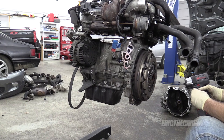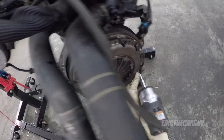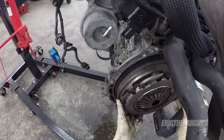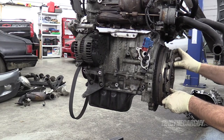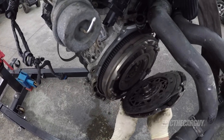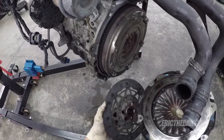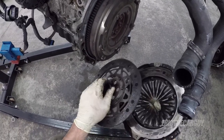This looks like an E10. That doesn't inspire much confidence — I know it's dual mass and I've dealt with dual mass in the past, but I don't remember it wobbling around like that. What is a dual mass flywheel? Well, all clutches when you apply them need some sort of dampening, and what they normally do with many clutch discs is you'll see a spring or a series of springs inside, and that gives it some dampening force when you apply the clutch.